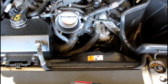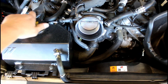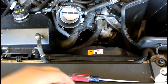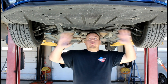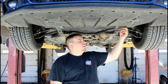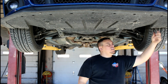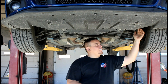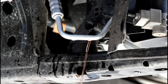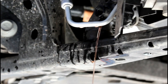We can't really do anything else until we drain the fluid, so let's crack this lid and then we'll go underneath and drain it from the drain plug on the radiator. There are a bunch of 7mm screws all around here — just take them all off. We've got these little pull-lock plastic tips, one here, one here, and another one on top — three on each side. Pull out the white plug on the passenger side and let all the antifreeze drain out.